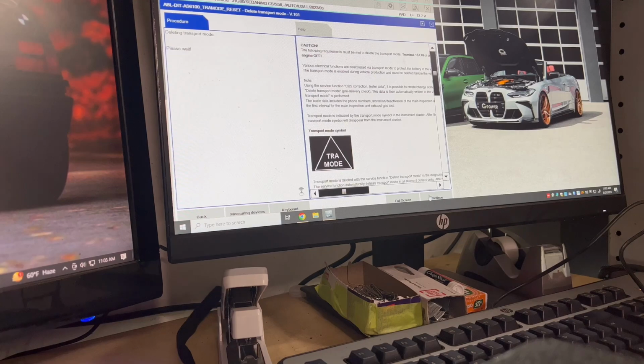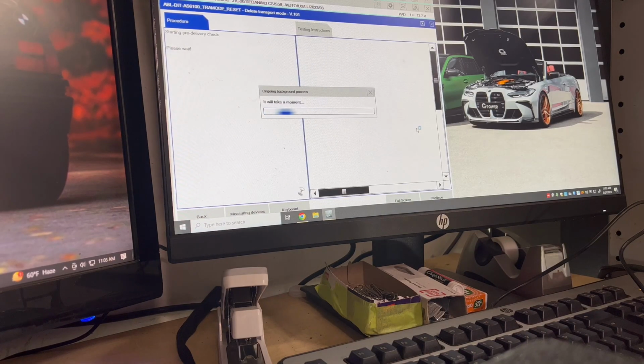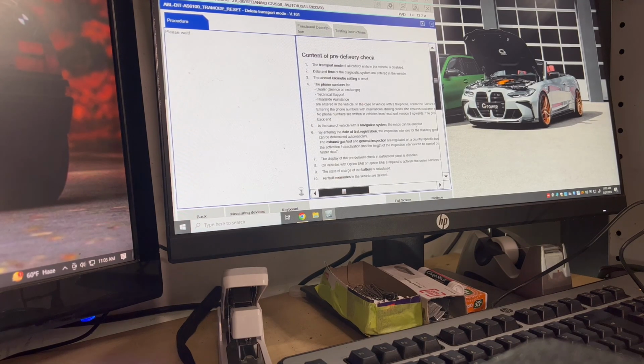and we're also going to check the cleanliness of the engine compartment, maintain the exterior paint surfaces, check for the appropriate fuel level. We're going to go to the fuel station and put in some 91 octane. We're going to program the radio, top up the washer fluid, remove the shipping spacers that M vehicles have. Kind of just helps them from bouncing around on transportation. We're going to make sure that the BMW Assist test call is functioning properly, make sure the windshield wipers work and all that, the navigation road maps all work.